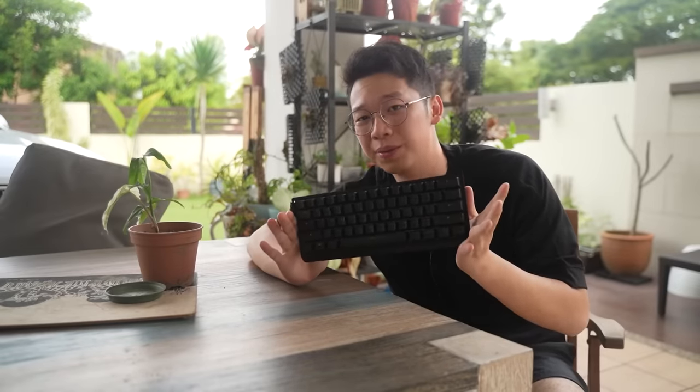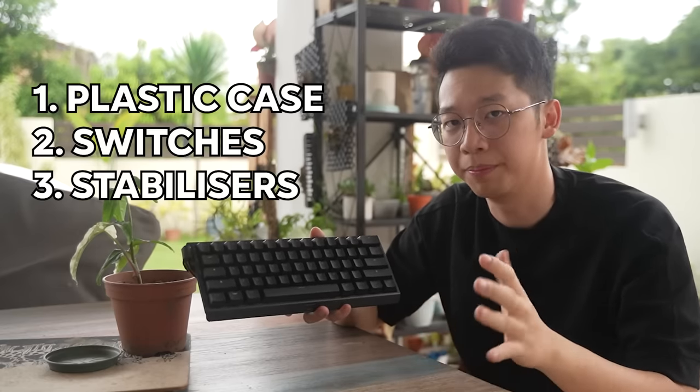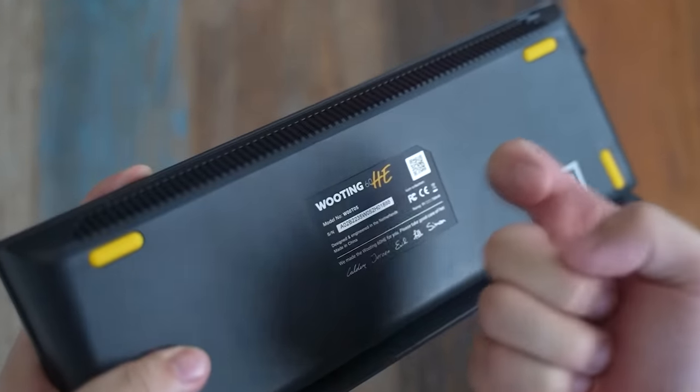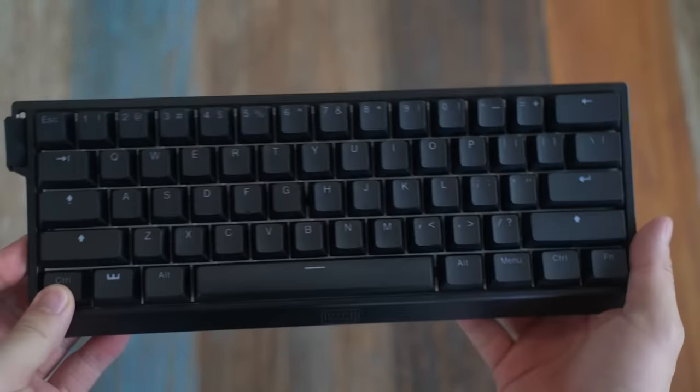So let's start by identifying what is wrong with this keyboard. The few things holding it back are its plastic case, its un-lubed switches, and its stabilizers, which are pretty mediocre. Using a plastic case can make your keyboard sound hollow, and that sounds cheap. People cope by putting foam in it, but it's still going to have that plastic sound to it.